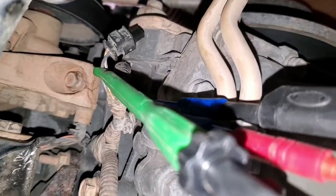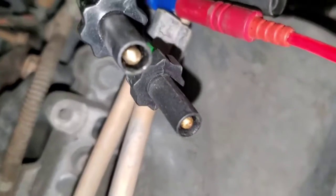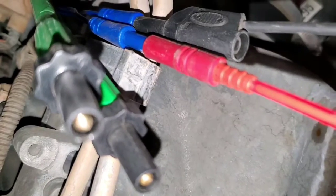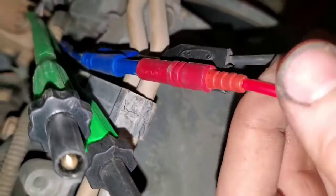So I decided to send my own voltage. I ohmed out the pump and it was 1.7 ohms, so that seemed about right. But I thought maybe the pump is overloading the ECM circuit, causing the voltage to drop.